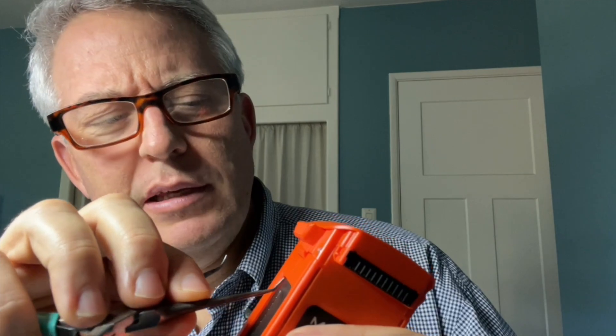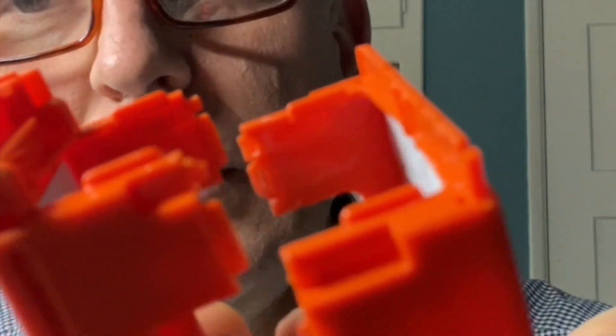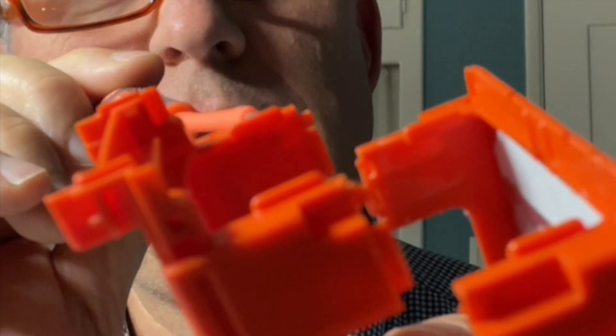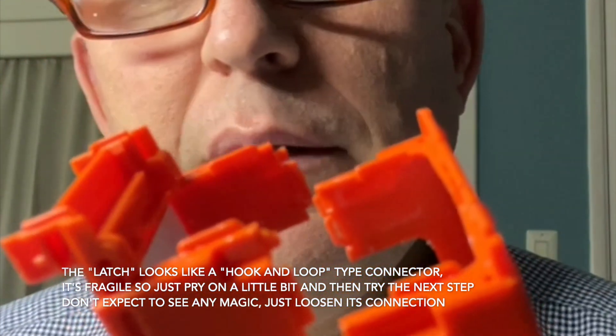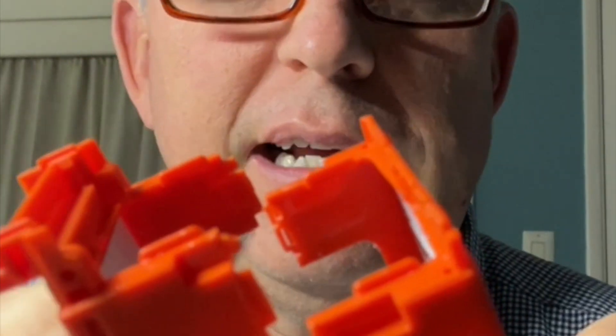It's really the same approach as before. The same needle-nose plier tool worked well — you insert it along the seam between the black plastic piece and the other piece. But there's one step before that. Looking inside, right up at the top on both sides there's a little piece with a hook. First thing you need to do is pop that hook and loosen it, then you can come along the back side and use your needle-nose pliers — wedge it in and separate it.